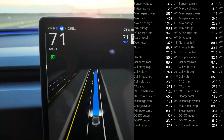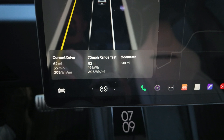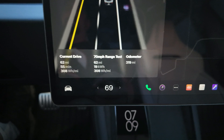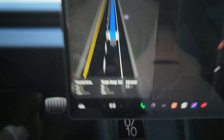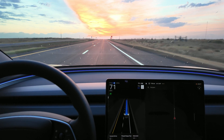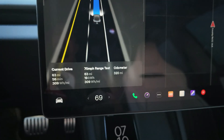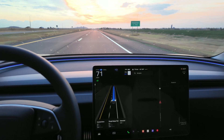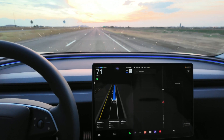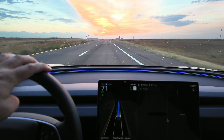Here we are at the 75% check-in. It's not quite sunrise yet but getting close. We're at 75%, have gone 62 miles, used 19 kilowatt hours, and 308 watt hours per mile. Keep in mind I took out the aero blades, so I'll be at a slight disadvantage for the watt-hour-per-mile situation. The driver monitoring system is very on point in this car — I can't look away for a few seconds without it telling me to watch the road, and then it beeps at me.